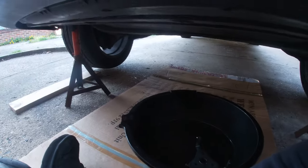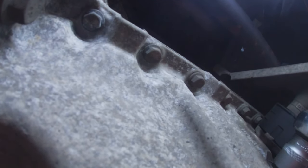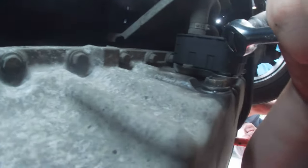I'm going to position myself under the car. Right guys, I'm directly under the car. There's the sump plug, there's the oil cooler — we don't need to do that — and there's the filter right there. I've got my 18 millimeter socket here, but it's very tight under here. I'm going to have to align my drain pan.